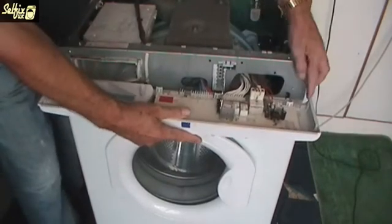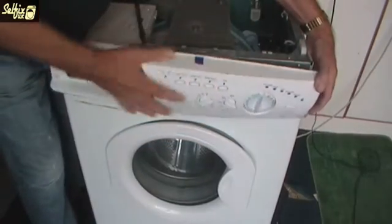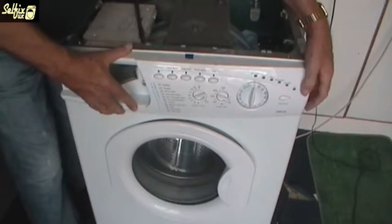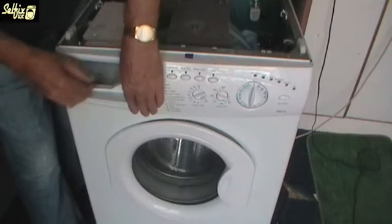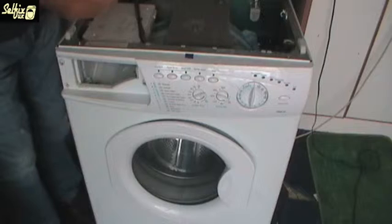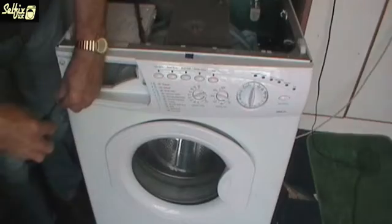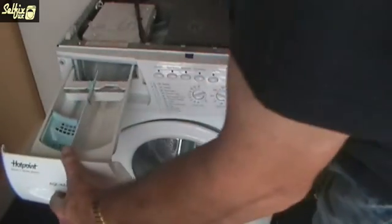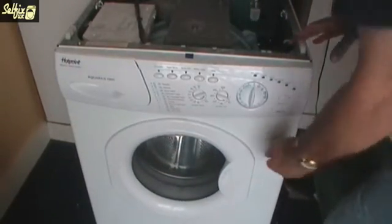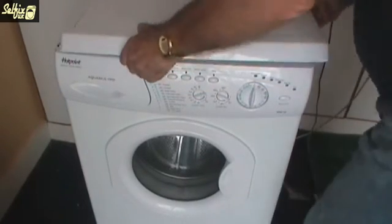When you've checked that all the terminals have been fitted correctly, lift the fascia up and hook it into the bracket. Make sure the wires don't get caught as you refit it. The edge of the soap dispenser fits inside the opening on the fascia, so you'll probably need to jiggle it about a bit just to get the screw holes lined up. When they are lined up, fit the screws but don't over-tighten them because you are screwing into the nylon dispenser and could easily strip the thread. Refit the dispenser drawer and replace the top. Make sure the door is closed as well.